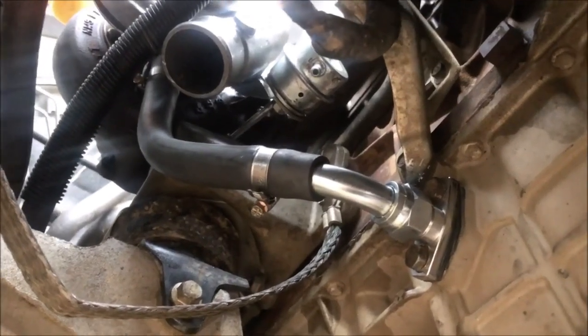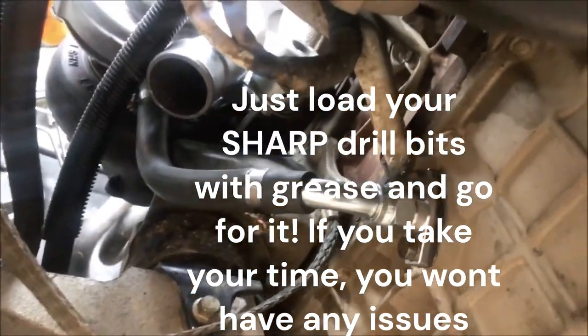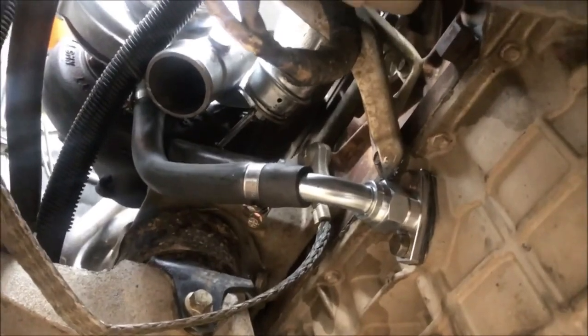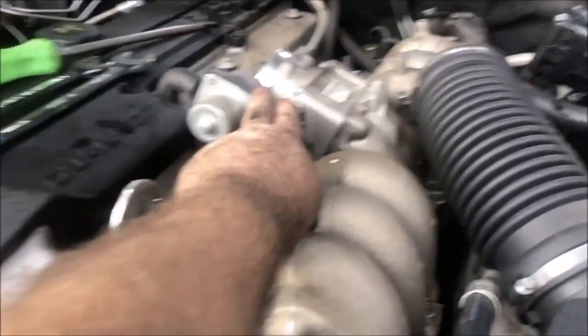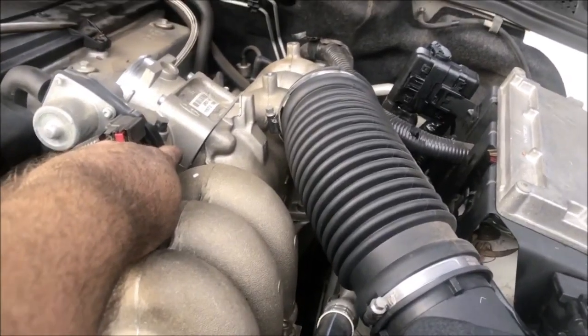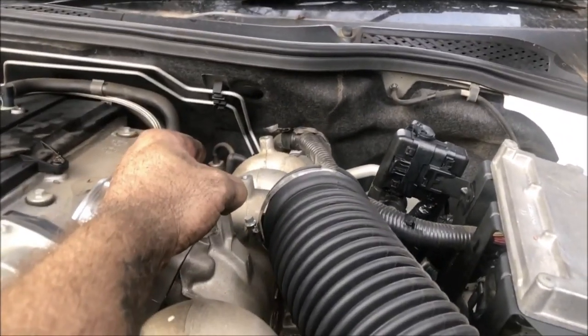Oil return's done — that wasn't hard. I wasn't sure if my drill would fit between the chassis rail and the sump, but it did. So all my oil and cooler lines are done. On the top, I've got to remove the throttle body so I can replace the MAP sensor with the one for the turbo, which is 2-bar. I've got a 4-bar fuel pressure regulator to put in to replace the NA one.